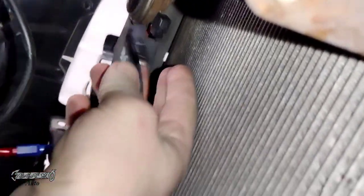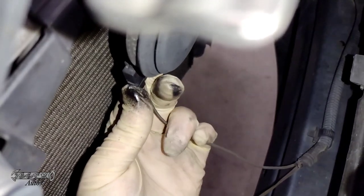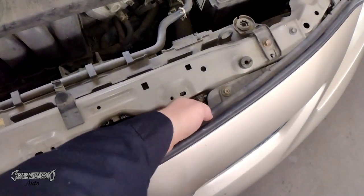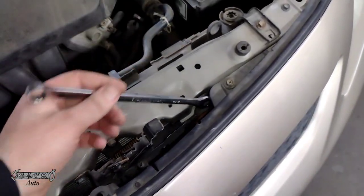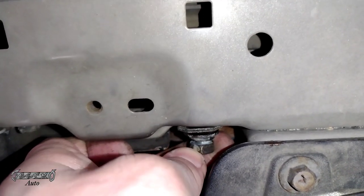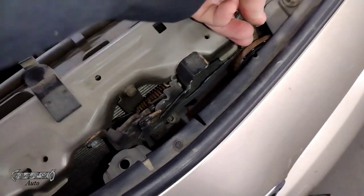Or just pull some of the bumper forward so you can reach in and get it. This is a repaired wire harness — I'll show you how to repair it. What you can do is loosen up the 10 millimeter bolts in the front of the bumper and pull the front of the bumper outwards, loosen the screws, and hopefully you'll get enough room to get the 12 millimeter in there. Even without that, if you have skinny arms and small hands you can probably sneak it out, or just loosen the bolt and let the old one drop down and get it from there.